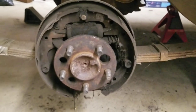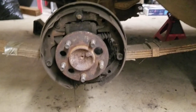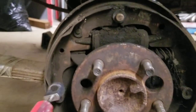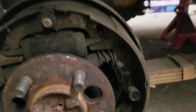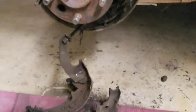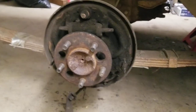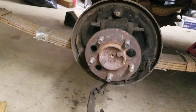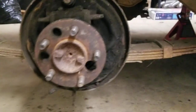You never know when something's going to fly up and get stuck in your eye. I've had enough metal stuck in my eye even from wearing eye protection — it can happen. Wear eye protection, ear protection. Top springs are off and the keeper right there. I'm going to try to do this with one hand while I'm filming. Sometimes you've got to hold the back to keep that anchor from turning. Those are off. I'm not being super careful with any of this because we're not keeping any of this stuff. Get all your parts out of there. I save them though, because I use different pieces for other brake jobs. But in this case you're not using any of this stuff, not even the backing plate. We've got all that stripped off, undid my parking brake cable — it's just hanging there.